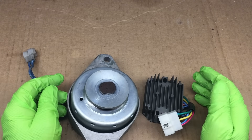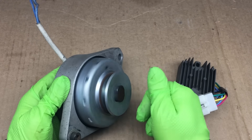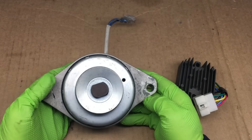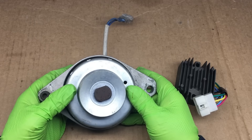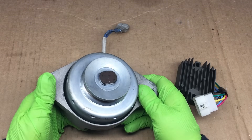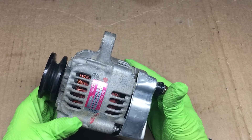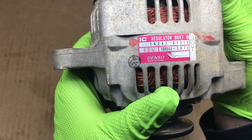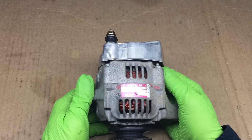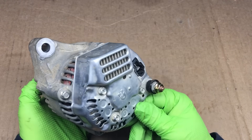Now that we got most of the wiring out of the way, let's talk about the charging system. In the past, we've been using this 20 amp alternator with an external regulator. I really like this setup because it provides just enough juice to keep the battery charged, and it's cheap. On this project, the electrical load on the charging system will likely be a little bit more than this alternator can generate, so it's time to say goodbye to the 20 amp alternator and say hello to this 40 amp alternator. This 40 amp alternator is made by Denso and it's actually made to be used on this little diesel engine. Something like this ain't cheap — expect to pay about 70 bucks — but this guy was sourced from eBay for a mere 25 bucks with free shipping.